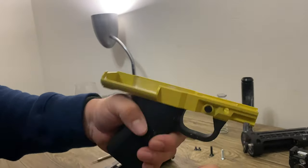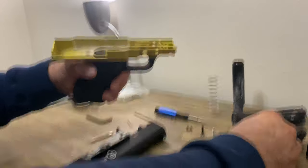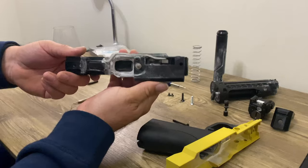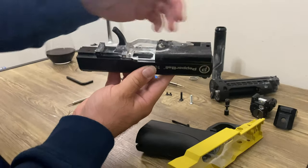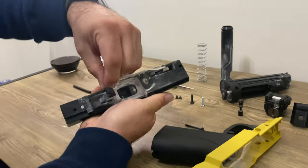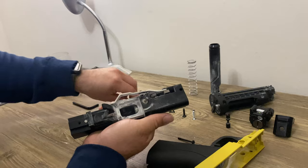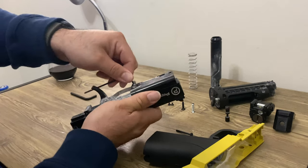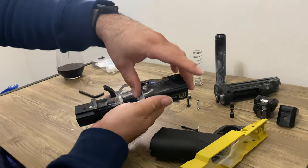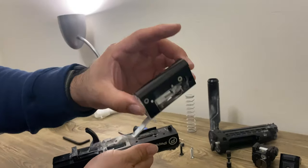As far as I'm concerned, it's not designed that way. So I'm going to be cleaning all this. Here is the regulator — I'm going to take this off. To do so, you just take out this rubber piece right here, then you're going to take out the regulator by removing that screw there. It is filthy, so I'm going to wipe all this off and grease it up.